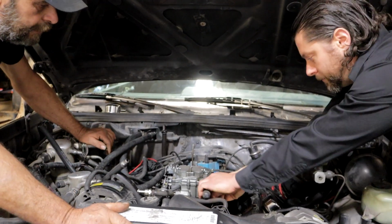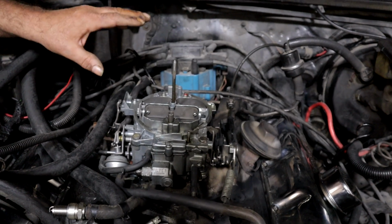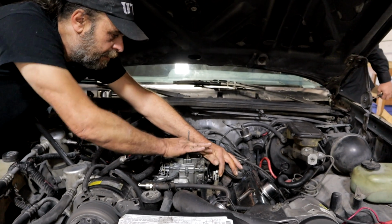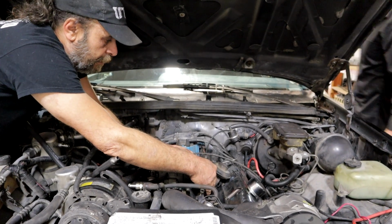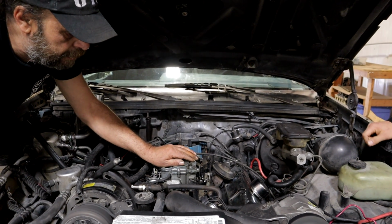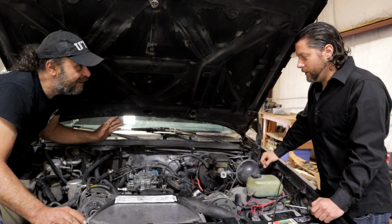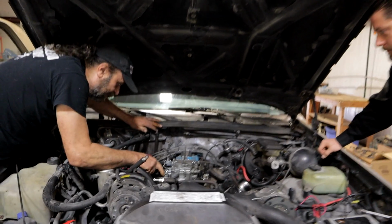Take out one full turn. Take it out. Yeah. But I want to establish the throttle position for the idle RPM we're looking for. It still has a vacuum leak, but we're moving closer to the problem. So start it up again. All right, one more time. Then we put the breather on it. No, it's still, we have less of a vacuum leak, but we've still got a crazy kind of vacuum leak.